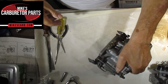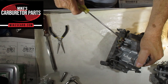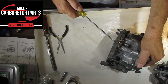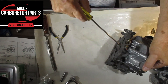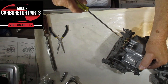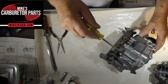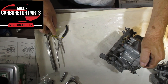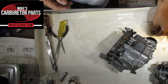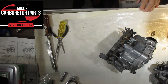If you can't get a good steady RPM by adjusting these screws, you've got a carburetor trouble inside — it could be dirty idle passages. Take the screws out and blow through with carb cleaner, making sure it goes out the other end. With the carburetor apart, find all the small passageways that go to the idle mixture and make sure they're all cleaned out.